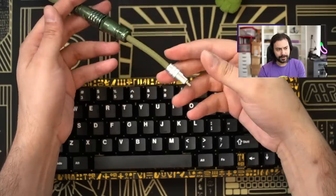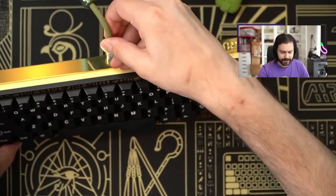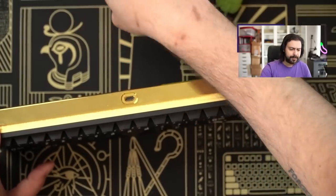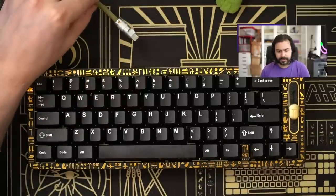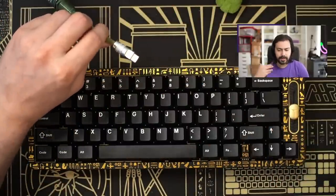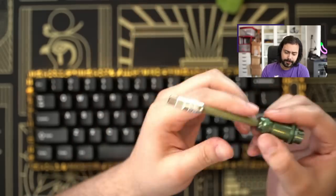so I've got this cable here that I use for a lot of my testing, and I had an issue with it where it wouldn't go all the way in. So I push it all the way in, it's not in. Push it all the way in, it's not in. The USB port sits just like a millimeter and a half to 2 millimeters too far in for something like this. Now, using a normal USB-C cable that like comes with a phone or whatever works just fine. It's just the dimensions of this particular one isn't great, but like having a port inset just that much is kind of annoying. It means that this portion of your USB-C cable needs to be longer than average. And, you know, for a lot of custom cable jobs, especially considering that this particular head is a fairly common head when it comes to aftermarket, like nice coiled cables, this just won't work. So, yeah.